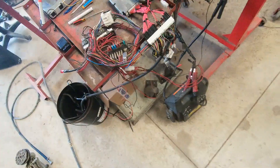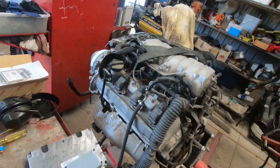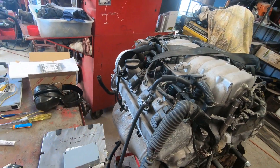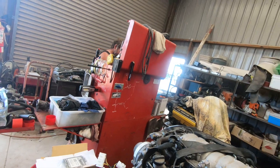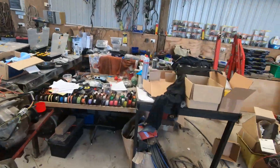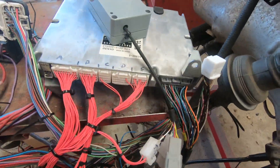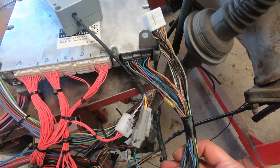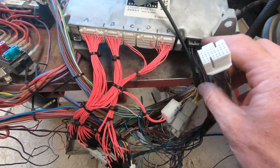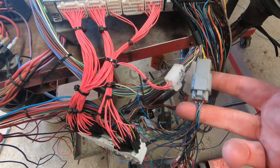I've got one more to test today. That one I've actually done a little bit different — this one is set up for a manual. The other one I'm going to do, the man's going to wire as an automatic. So we're going to swap that one out and test another one. With this one being wired as an auto, the customer sent me down the fifth plug — the E plug — and the F plug. I've just tapped in the immobiliser box to the relevant wires.